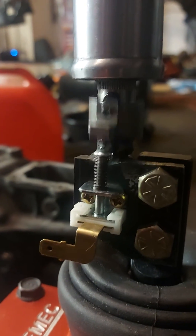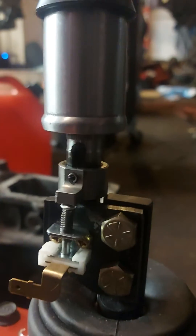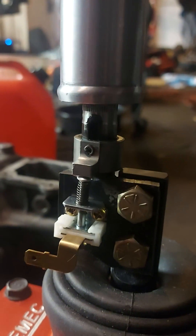Whenever you pull up on the collar, it will close the switch and you'll get power to the solenoid, and then you'll be able to go into reverse. When you let go of the collar, the switch opens and the reverse lockout is active again.